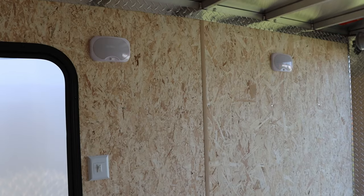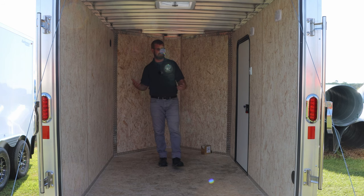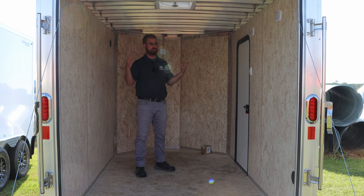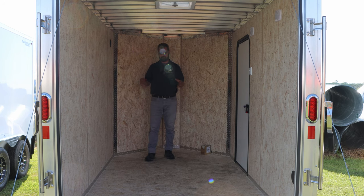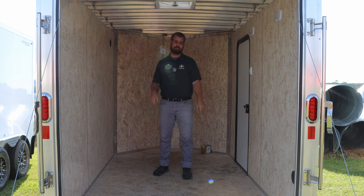Two LED dome lights are standard. If you take a close look at the fit and finish of a Legend trailer versus other brands — diamond plate edging, band edging on your walls — it really classes the trailer up. All aluminum frame: 24-inch centers on the floor with 2x4 main frame, and 1x1.5 tubing on the walls and ceiling at 16-inch centers. They beef that up on the walls since that's your moving part going down the road. In behind the diamond plate on the back corners — your top corners, whether it's a barn door or ramp door — they put an extra welded plate in there for reinforcement. Those are the corners that shift the most going down the road, that catch wind and move the trailer. Trailers without those added reinforcements and without a full box frame for their doors will have doors going all over the place. Legend's full box frame keeps it rigid.